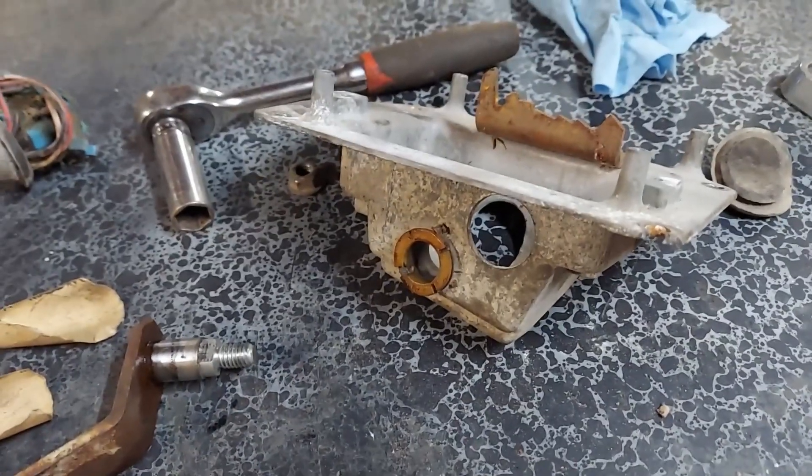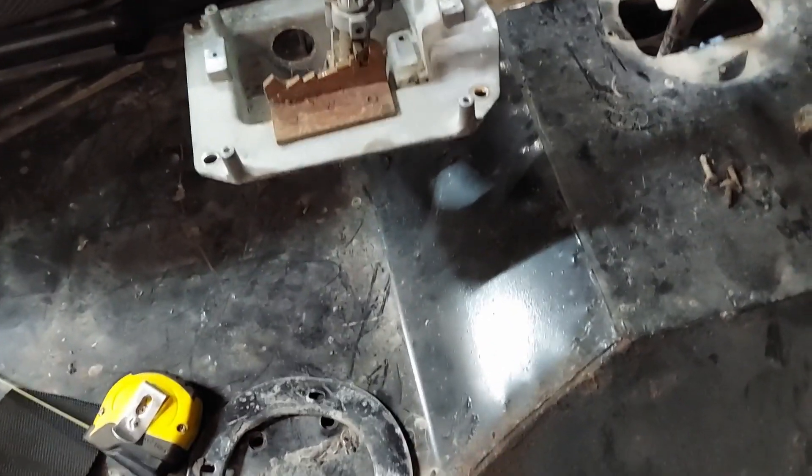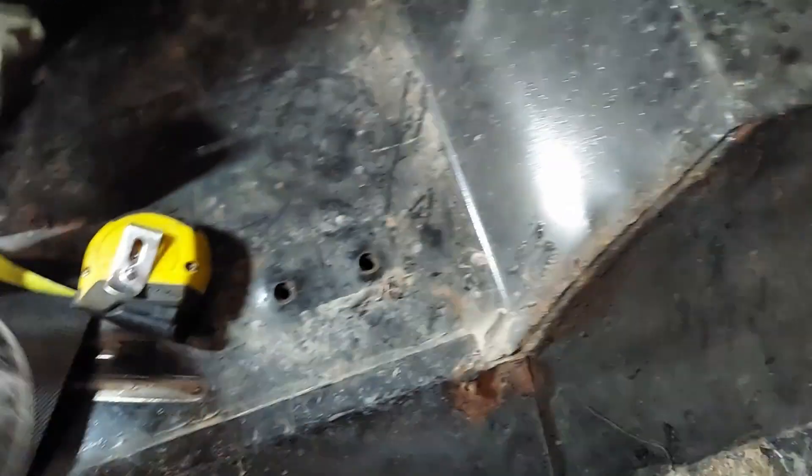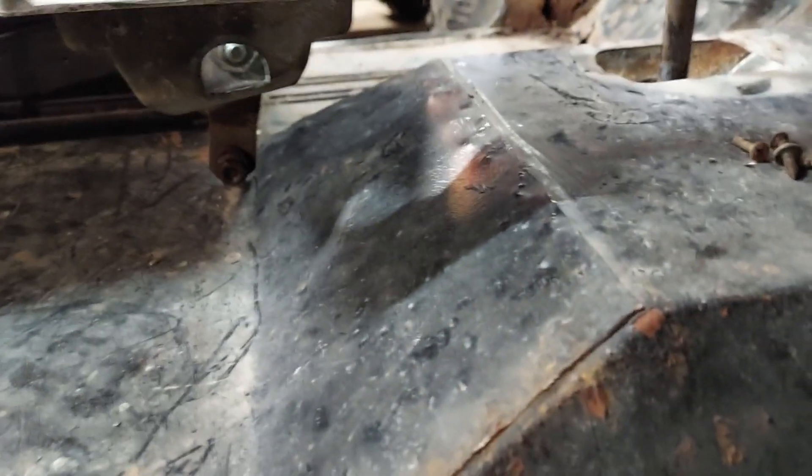So I can get it put back together now. Messing around with where I want to place the shifter, I've got a problem here — there's that big reinforcing channel that runs through here, so I can't really go messing with that. The linkage and this arm are going to kind of have to run right up in here, so I'll probably have to build a box right about there, maybe forward a little. And as you can see, the transfer case shifter is going to interfere with that.